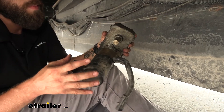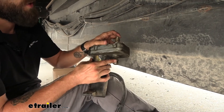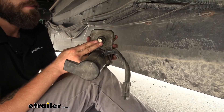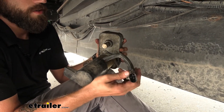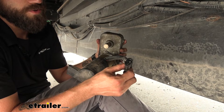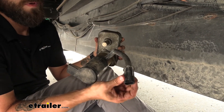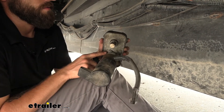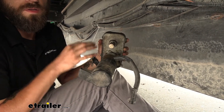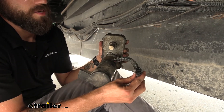When we look at our slide-out motor, there are a few different variations. This one, as you can see, is a double shaft. There are some types where it only has a single shaft. There are different variations in the kind of connection — there are a lot of hardwire versions. This specific one comes with a connector, and there are a few different types of connectors. So you want to make sure when you're verifying all of the information on your slide-out motor that your new one is actually going to match up the same way.